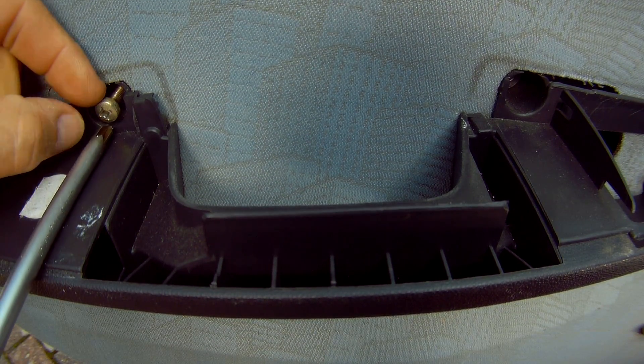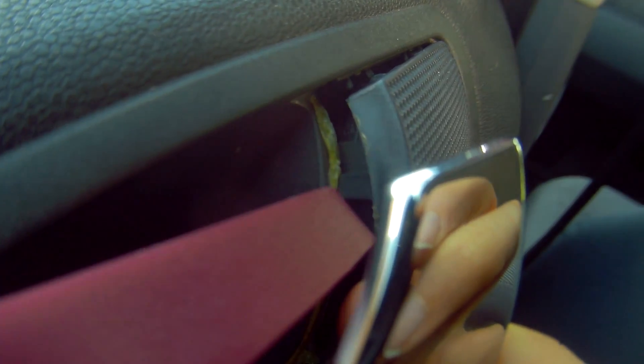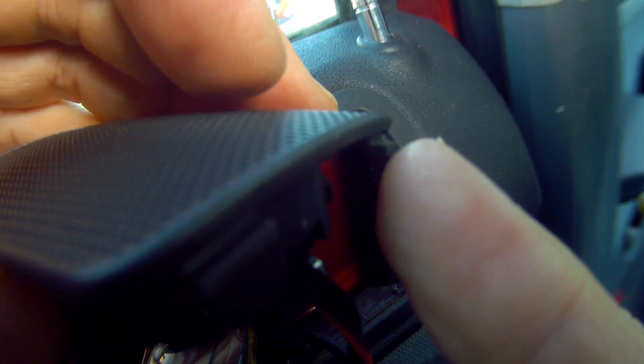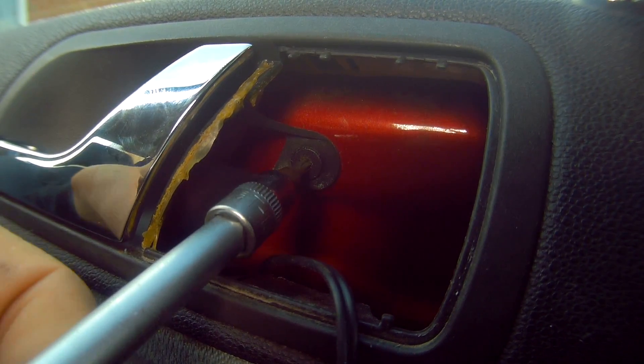Take those out, and then there's the most difficult, fiddly bit — the speaker grill you've got to take off by the opening handle. You can easily damage these little grills as the tags are very brittle, which is what I've done on this one and had to resort to gluing it back in place. If you look carefully behind the handle lever there's a little slotted mark right in the centre, which indicates where you need to push a trim tool in to depress a little catch. Try to lift it out from the handle side, hinging on the pillar side, as the little hook tags easily break if forced. Once you've got the speaker grill out, take out the T15 screw just here, being careful not to drop it down inside the panel — although if you did, it'll come out of the bottom when you take the panel off anyway.